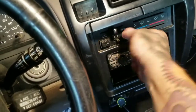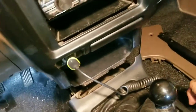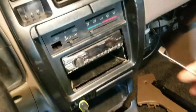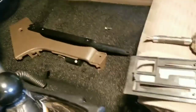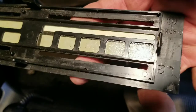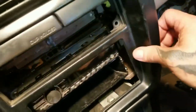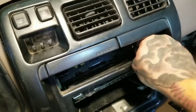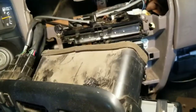I forgot to pull that plate first. When you pull that plate, your AC button comes out — it's supposed to do that. You just reach in here with your little clip and give a yank. It's just held on with some pinch fasteners in the center and on the ends. Pull from right around the middle area. Now there's supposed to be a screw that went right there, but that screw is missing in this dash. I'm hoping the new dash has the right screw placement. I just put some sticky tape there to keep it from rattling.